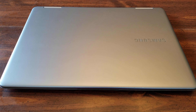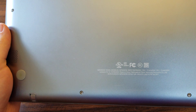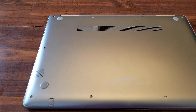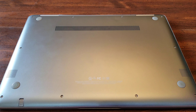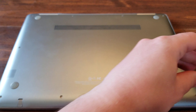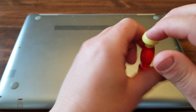Hey, what's up guys. Today I'm going to do a short tutorial on how to replace the battery for a Samsung Notebook 9 Pro, the 15-inch version. Specifically today I'm going to be dealing with model NP940X5M. Pretty simple — you just have to remove all the screws that you see on the back here. All you'll need is a small Phillips head and possibly some sort of small prying tool, but not necessarily. They are very small screws so make sure you don't lose them.